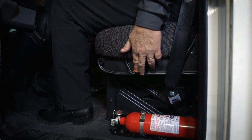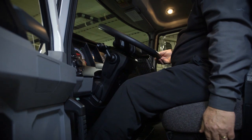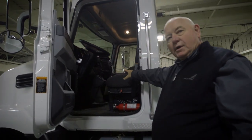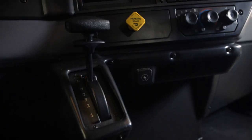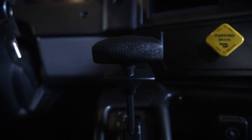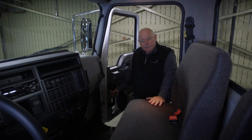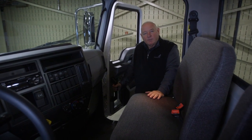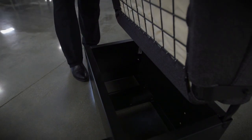Getting into the truck, you'll see it shares a lot of components found on other Mack products, including a tilt telescopic steering column, flat bottom steering wheel, and power windows and door locks. To enhance interior space, we've taken the transmission shifter and mounted it to the bottom of the dash, which allows us to facilitate three-person seating. The standard seat is a single passenger seat, but this seat was designed specifically to accommodate three-person seating, which is key for medium duty. It also provides easy access to additional storage space under the seat.